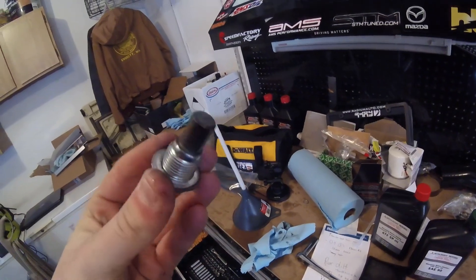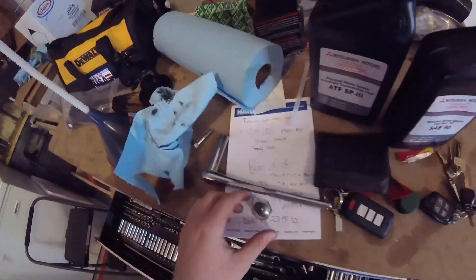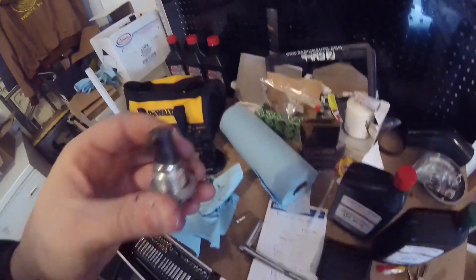Got it all loosened up and there we go. To speed up the process you can take out the fill bolt as well. I'm going to take this drain bolt out since it has a magnetic tip — I want to see if there's any metal on it. It doesn't even look that bad. This transfer case has 60,000 miles on it and there were little to no metal shavings on the tip, which is great news. I'm going to clean it off a little more and then get to the filling part.